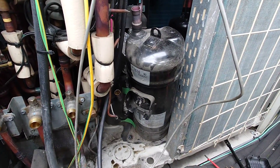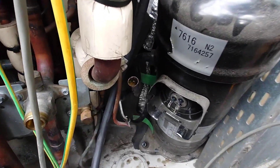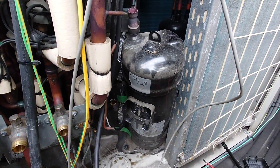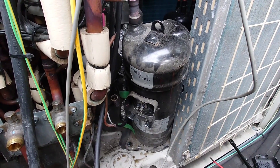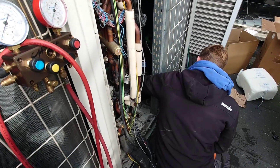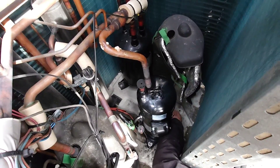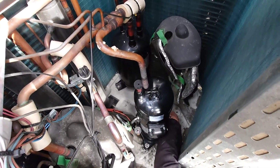The compressor is out and it does fit nicely through that gap. There's a little bit of gas still boiling off through the oil but we're not bothered about that. It just sort of unbalances itself and rolls through that little gap — it's quite straightforward using the carrying eye at the top of the compressor. The new compressor is in, we're just doing the bolts up now. Getting it in is just as difficult as getting it out, which wasn't that difficult to be fair. Three bolts go in place, then we'll braze the pipes back in.